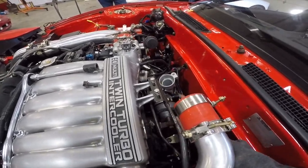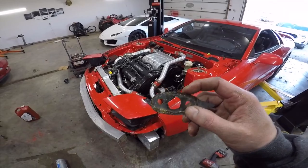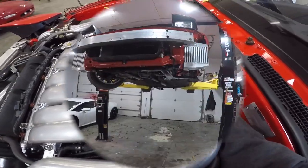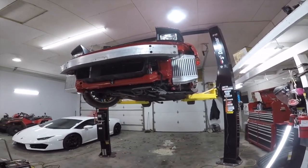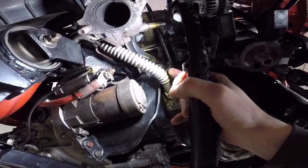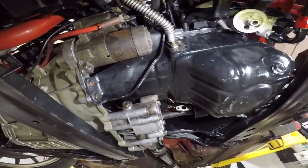I'm going to check the oil returns right now and let you know if I have to take this turbo back out. That return line looked fine — I could stick my finger in it, the oil pan was fine. So we took the rear turbo out. XS Boost is on his way over. I probably had seven quarts of oil in this thing, and I just looked it up — it only calls for 4.8 quarts. If oil was sitting above the return lines, there's no way for the turbo to return it, so it'll back up. That might just be me being a rookie — I don't have an excuse for that.